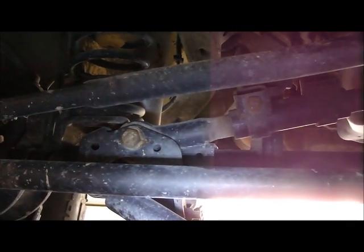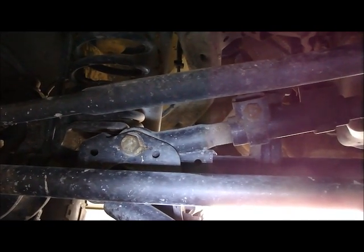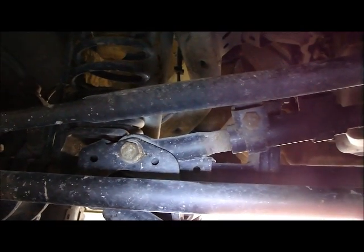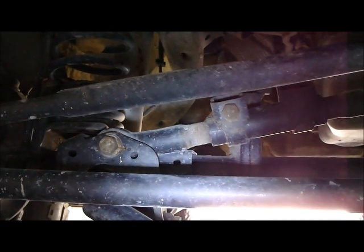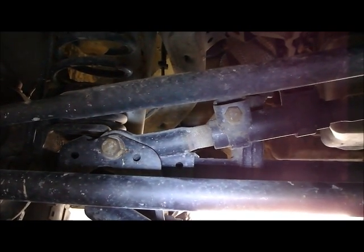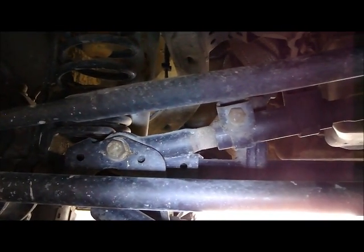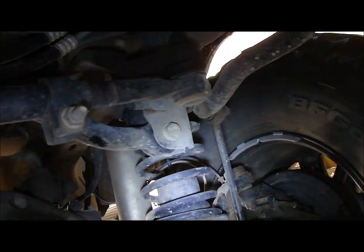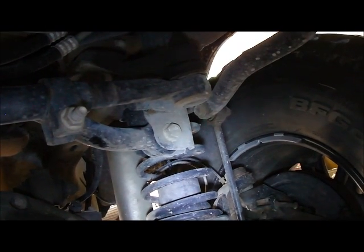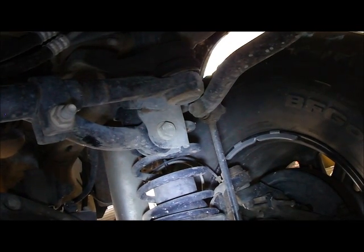That's quite a bit. And it's not uncommon for those bolts to loosen up a little bit as the suspension cycles, as the bushing bolt sleeve collapses a little bit in the ends of the track bar, or just from normal vibrations in suspension cycling. If those bolts loosen up from their 125 foot-pound torque specs, then that can cause a death wobble problem and a very severe side-to-side movement, and those bracket bolt holes can get ovaled out.